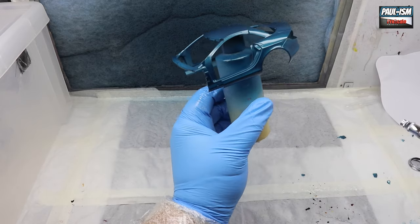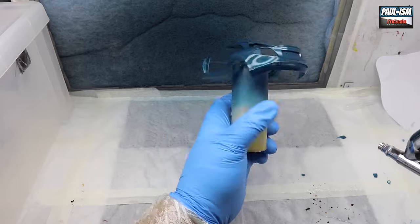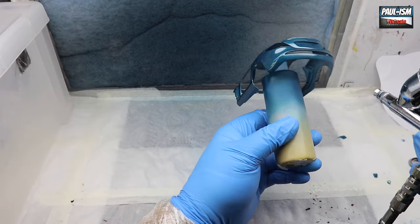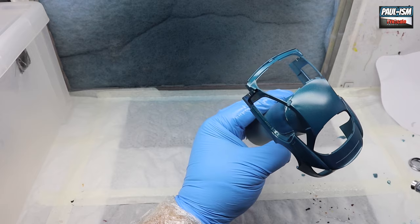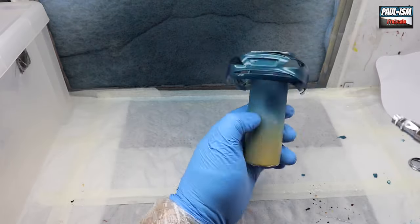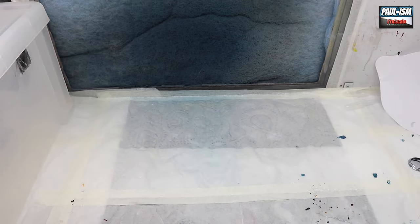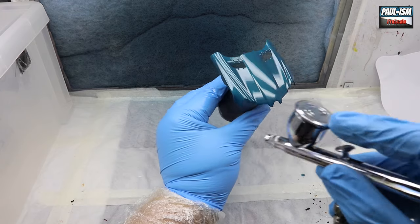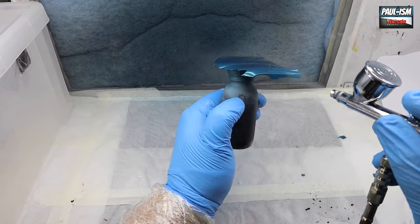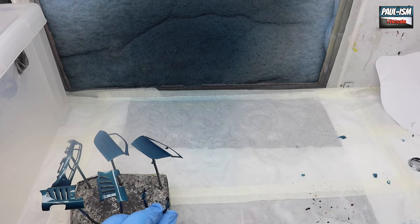We'll let that flash off for five minutes and we're here for our second coat. This is still the first mixture with 10% thinner in it, and this time we're going to put our full wet coat down. We're not trying to get a perfect finish off this coat — just going even all around the body with overlapping lines of wet 2K. Then we'll pop it back in the box for 60–90 seconds while we 2K the rest of the parts. Then we're going to thin that 2K a bit more for our final coat.